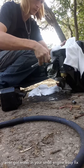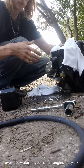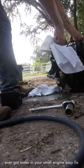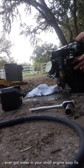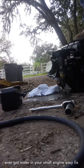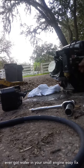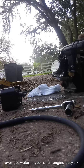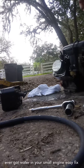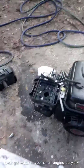You just want to tighten your plug back up, not too tight. Put your plug wire back on. Turn your fuel back on right here, and then just fire it up. There we go guys — running! Water straight down the intake, ran up like a champ. Simple guys, really simple.